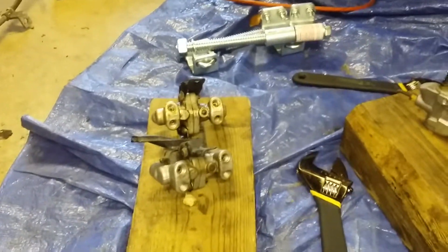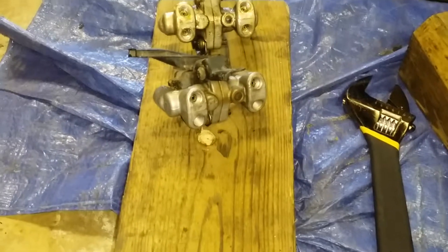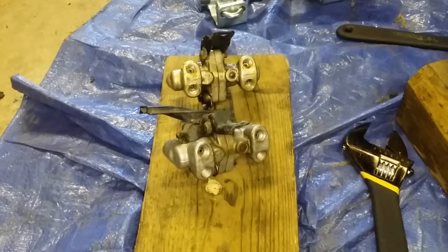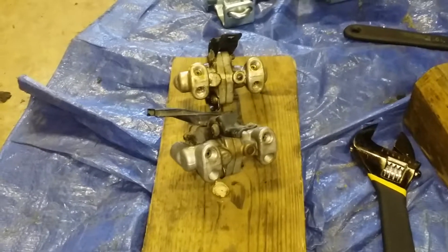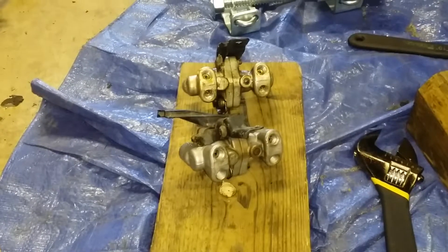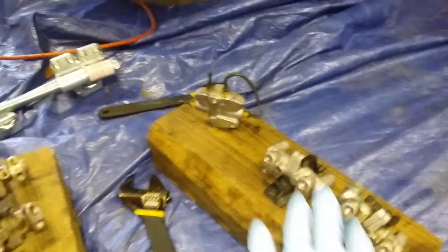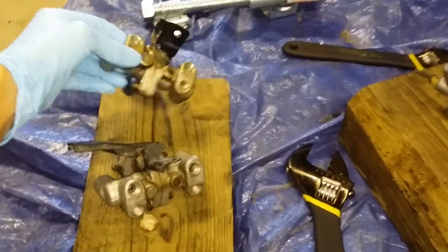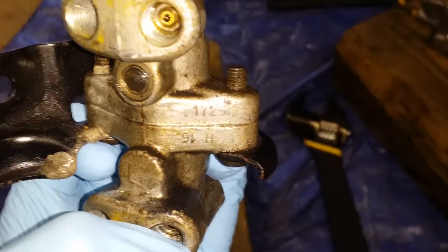Now I have the prop valves. I've read so much information on these and nobody really knows much of anything. They say 14040 is the same as another, or it doesn't matter if you keep your proportioning differentiating valve or swap over to a proportioning valve for all-wheel disc brakes — it makes no difference. That's straight-up bull crap. They design those valves to behave a certain way for optimal braking ability. I have five prop valves here and one prop differentiating valve — the one that came off my car, a 1988 Honda Civic HF, has a 1725 stamp.